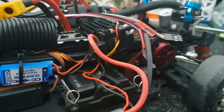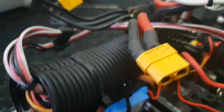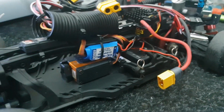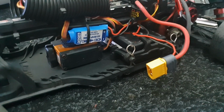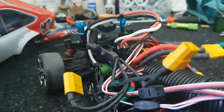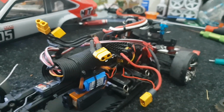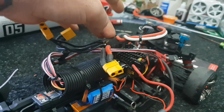So the Sidewinder 3, the Boom Racing gyro, the BEC, the Savox servo, you've got a 12 LED light kit, then you've got this smoke machine where you plug the battery into the smoke machine, then the smoke machine into the ESC. Right, we've got a lot going on. It's a 2S battery I run, 4600 mAh. They're a 90C, the graphene shorty pack. Very happy with the batteries, but yeah, the burn effect is not getting enough, obviously. Too much is going on while I run that. If I disconnect the burn machine, everything's going sweet. So it's definitely when I add this in.